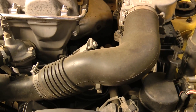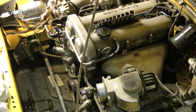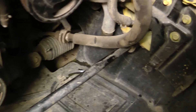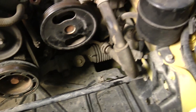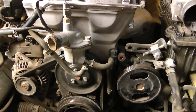In order to get at the lower rad hose, I'm going to start by taking off some of the air ducting on the front of the engine. Now I have the radiator out, and it was a little more awkward than I was anticipating because I didn't take off the bottom shield. That made it a little more awkward to remove the lower rad hose, which is fastened onto a pipe right about there. It was easier to take it off the pipe and then move the hose around to get past the front sway bar. But it's out, and the radiator looks in good shape.